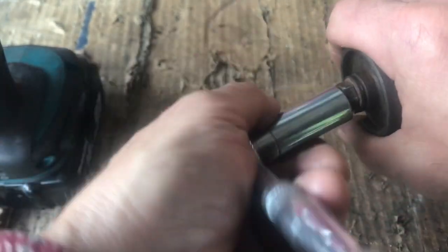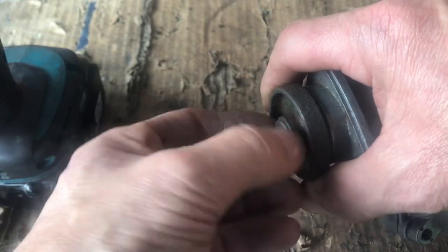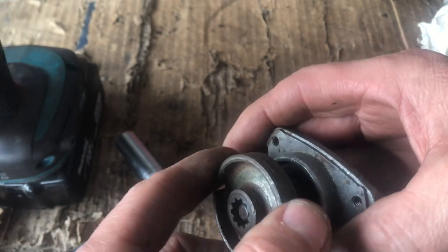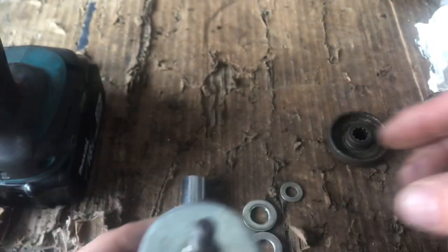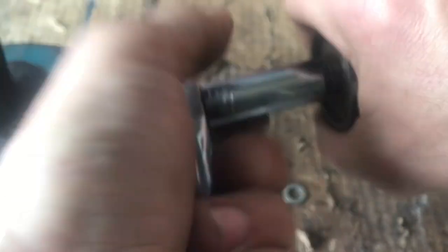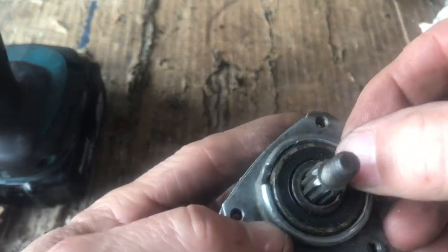What that means is you take that off. I don't need an impact driver — it's just a lot easier with one — take that off there. What's happened now is this inner one has come up to the same level, so it's getting stopped by the washer. You can see that's moved up now. So now we need to find yourself a big washer — because we've still got a little bit of space there — find a bigger washer, put that on, put that back on again, and tighten that up. You can hear it's coming, and now it's locked again, which basically means it's hit the top of that movement. It's come all the way up to there — now we've only got this last little bit.